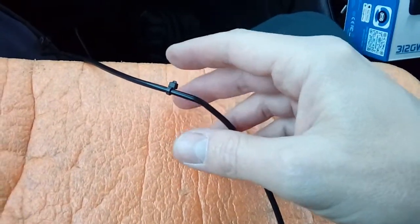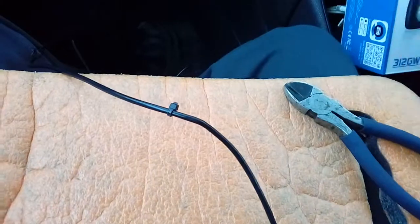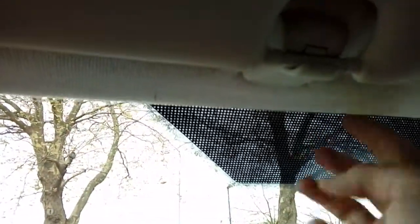Once you've covered all three in tape, you're free to gently pull your headliner down with your fingers. They're very fragile so just ease the cable under it all the way along so it comes down at the central fan area. Go all the way along the edge and then behind the trim pillar. If you have an airbag behind that, make sure you put the cable behind the airbag — though if they go off, they're powerful enough to move the wire out of the way anyway.